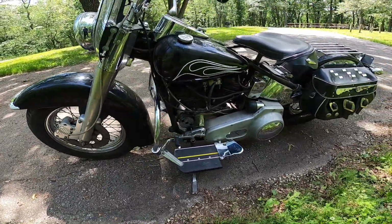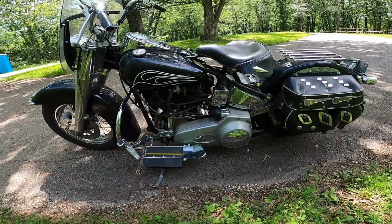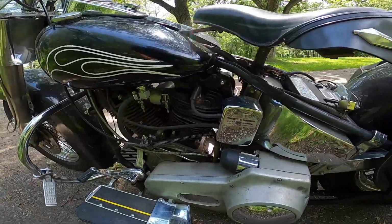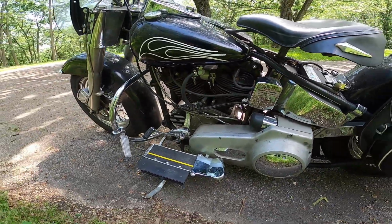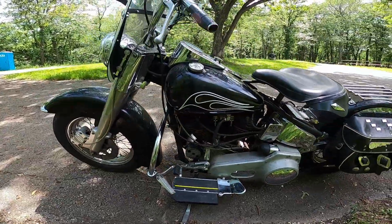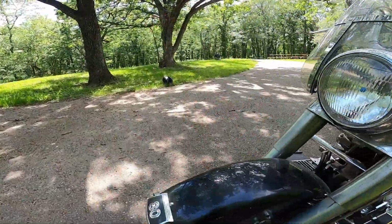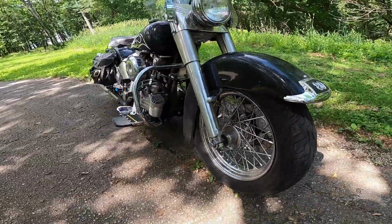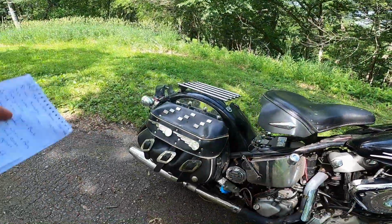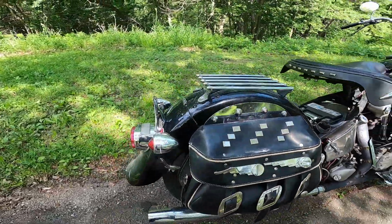He's got a York clutch pack in there, and the engine to the transmission, the primary connection, is a BDL belt drive limited primary. Very good. The tires are 5.16s, both front and rear, and I don't know what that translates into. And the bags he has in the back are neoprene. He did not want leather bags.